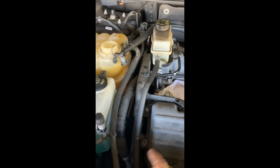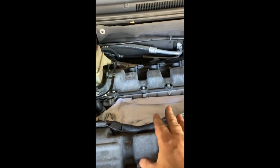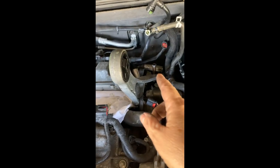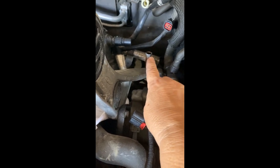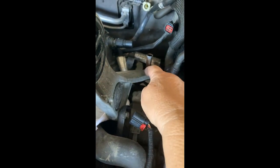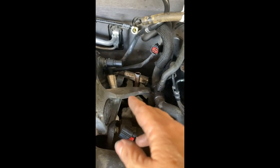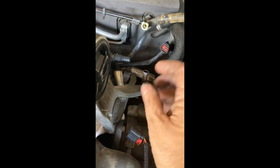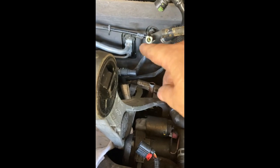We're gonna start where we left off with the solenoid and the fuel lines. We're gonna put the intake manifold. We're gonna reconnect everything back here. Don't forget to connect that pesky little rusty nut from the EGR valve, okay? And don't forget to put some anti-seize grease in there on the threaded part of the nut. The nut slid down. It doesn't come up because there's a lip right around the tubing. So just connect the EGR valve. Make sure that everything goes in there when you're putting the intake manifold. Don't tighten it. Just loosely tighten it and connect all these.